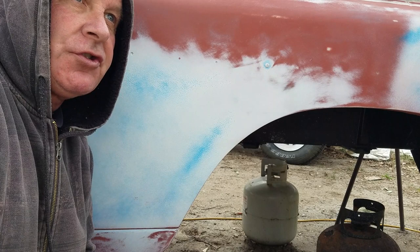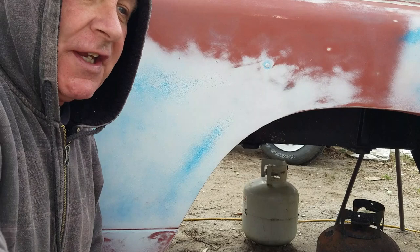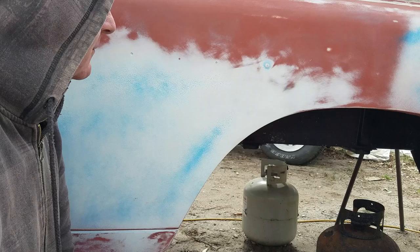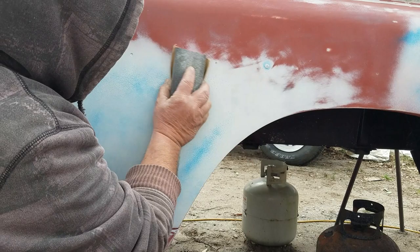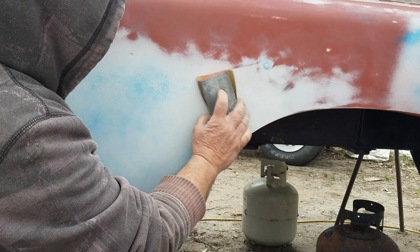Well, I was wrong — today's not a painting day. It's just 12 o'clock lunchtime and the temperature hasn't got over 10 degrees Celsius, so it's not going to happen. What I've been doing instead is blocking back where I've guide coated. You can see how I've worked my way along here — the whole idea is to sand it until the blue disappears, but no more than that. We don't want to cut through the primer and into bare metal again, but we do want to hit the low spots. The blue guide coat stays in the low portions as I sand, so I just sand until the blue disappears with a block, ensuring the panel is perfectly smooth.